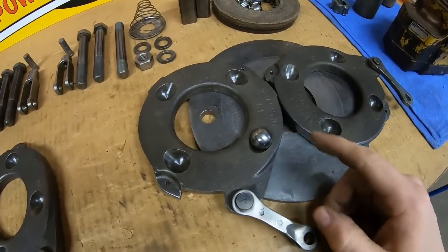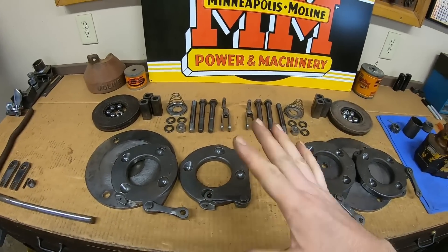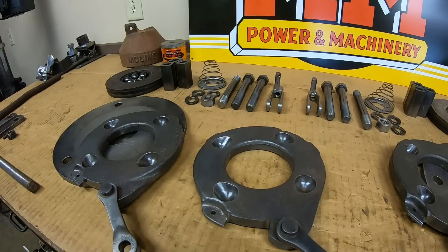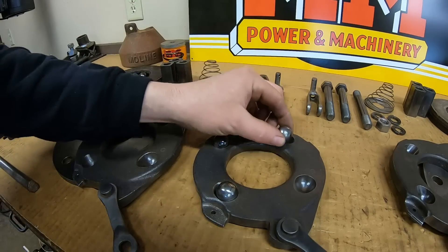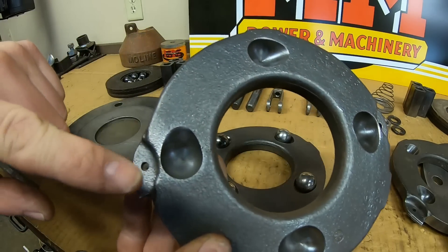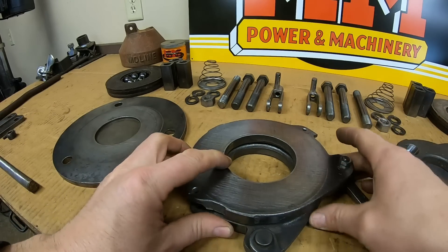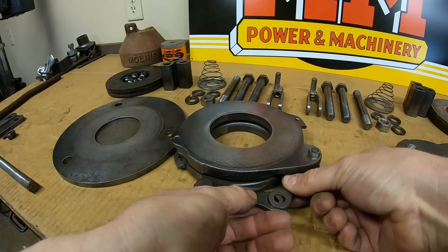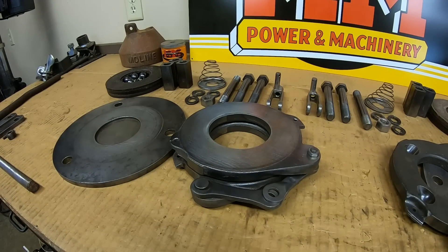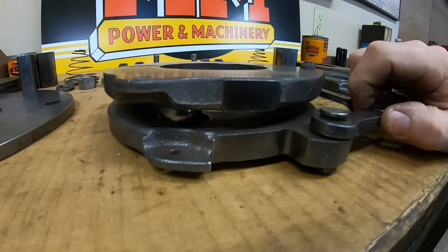The ball bearings were all in very good shape. Let's throw these pressure plate or actuator assemblies — as the manual calls them — together. I'll show you quickly how they work. Both plates are machined essentially the same, so the four balls drop into the pockets. The pockets are rounded on one end but tapered on the other, acting as a cam ramp. When put together properly, those cam ramps oppose one another, and you have the two pull rods come together in the center. The brake pedal pulls on those rods, and when pulled, you get a twisting action that spreads the plates — forcing them apart.